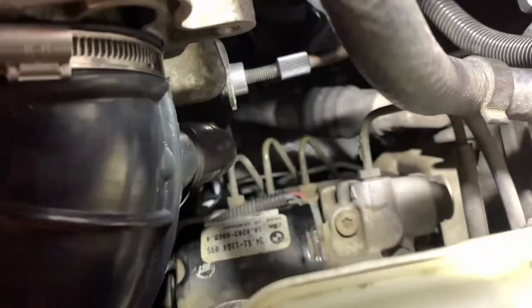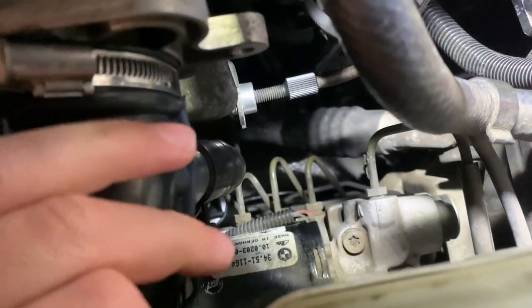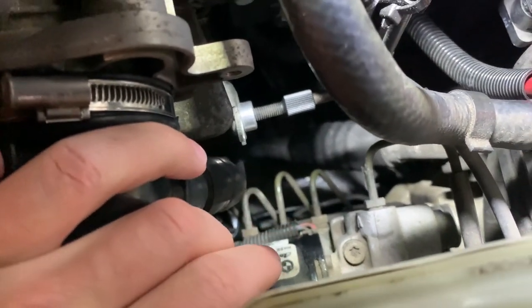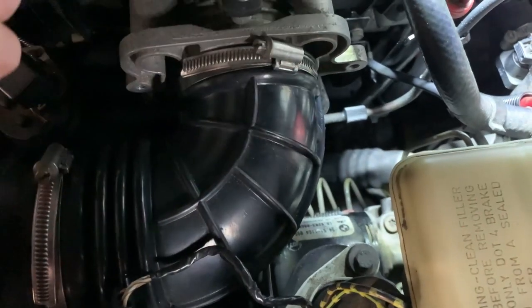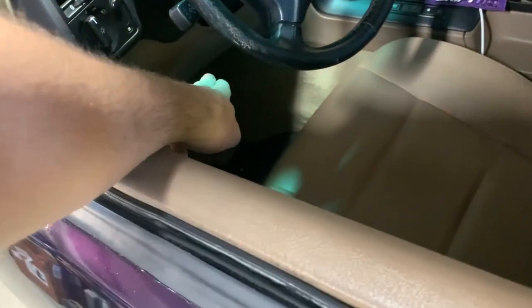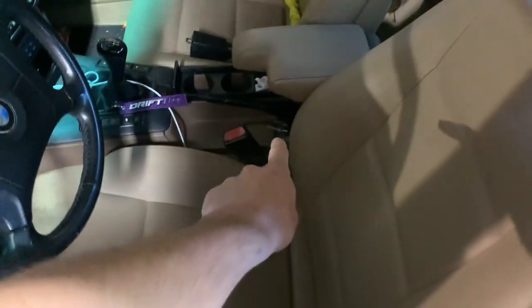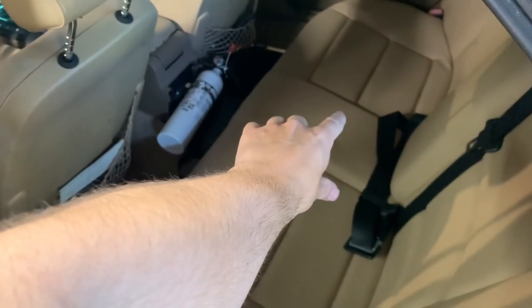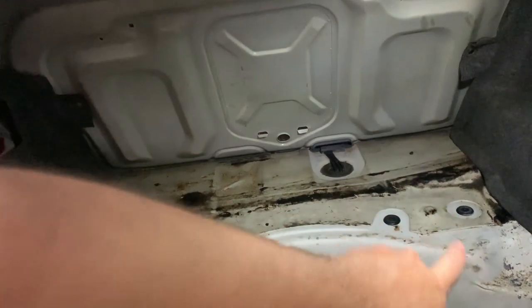Those two back lines — this guy and this guy — these are the rear lines. I believe one's a 10 and this one's a 12, so the kit includes those. These go down and back so I'll have to take these out, put in my lines, go through the car, drill a hole, and have that come up through the floor right around in there. Then it'll go through the handbrake. Back here we'll have another line and then it'll split into the tees — the two bulkhead fittings will split off and go down to the calipers. In theory it should be easy, I hope.